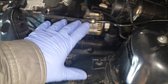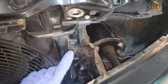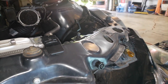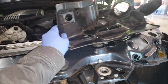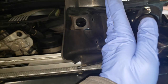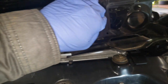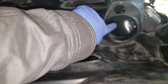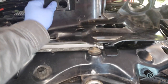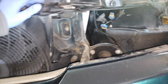You can see we now have a large void where we can put the Apollo system, but originally the air would come in through the front here, through this duct, around to the shroud, which I have up here. It would come through the front here to the shroud. You had a little bit of a gap here before the headlight system began, but it would come in through here, all the way down back here, and through a hole into the stock intake system. So actually, this was getting pretty good airflow the way it was, but that doesn't mean we can't sacrifice noise to gain some improvement.